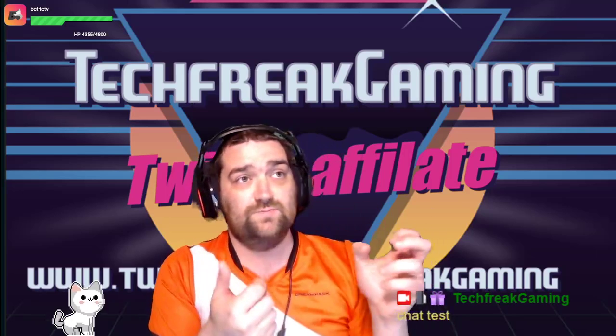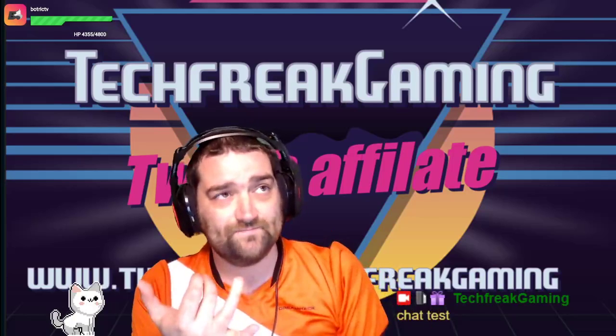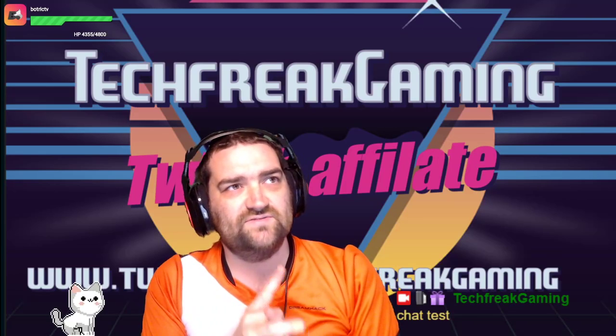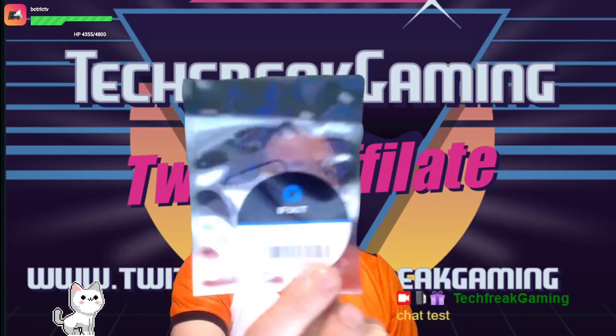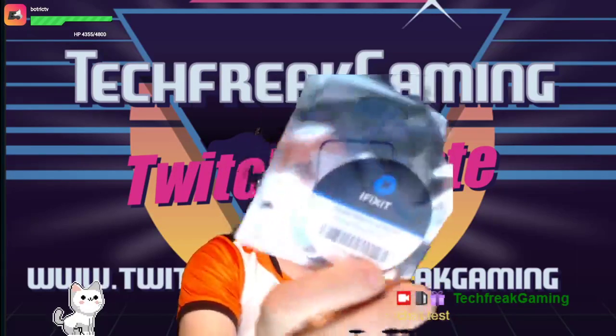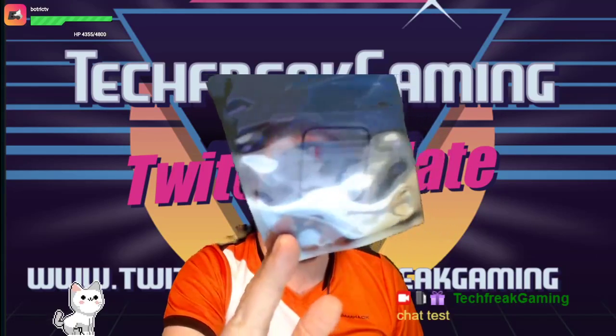So the issue that we've got is the screen has pulled away from an Apple Watch. So I'm going to be replacing the gasket because I've already tried replacing the adhesive. However, the adhesive did not take. So we're going to reapply. We're going to change the gasket. So we've got a little gasket there, if you can see that. Yeah, we've got a little gasket there in our little pre-packed package from iFixit.